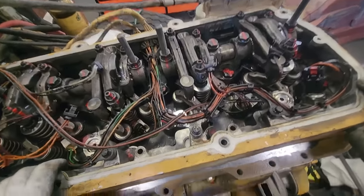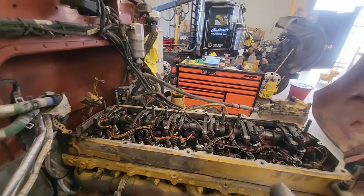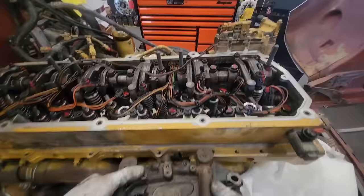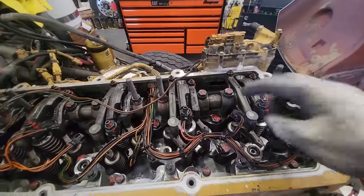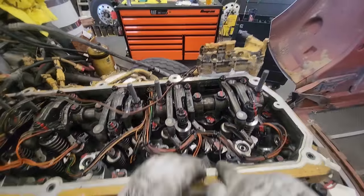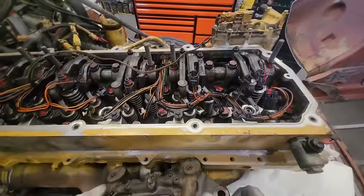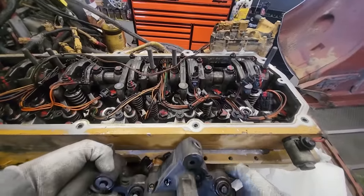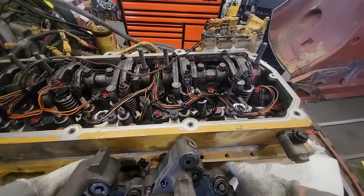That's your IVA oil pressure sensor — the only oil pressure sensor that CAT has under the valve cover on these truck engines. We've got our cleaned injector and IVA housing here. All C13s have IVAs. Notice that O-ring — that's what feeds oil to the IVA and Jake housing. If you have to do an IVA oil pressure sensor, do it now. One thing to check: roll this over and make sure the old O-ring is not still on there, because you don't want to double-stack those O-rings.